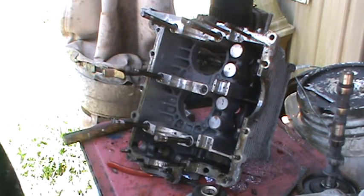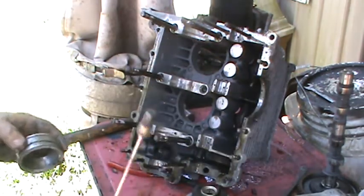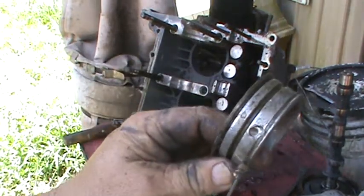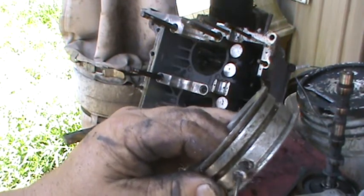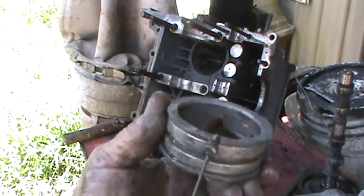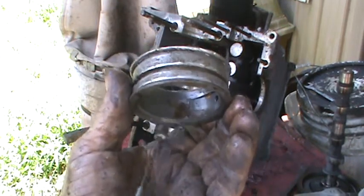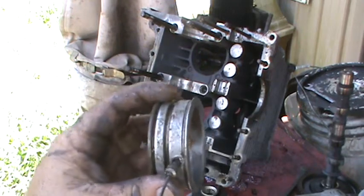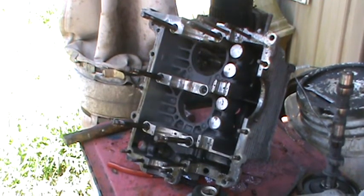This one's pretty much toast. A lot of guys would probably use this, but it's a failure waiting to happen. You can see the dowel pin that holds the bearing in place, and the hole — this more than likely happened during assembly. This is what I tell you guys: mark your bearings. Somebody put this together and smashed the dowel pin, and eventually the dowel pin went over in the hole. When you do this, it smashes the bearing in the back, the crank will seize up in this bearing. You can see how much copper is right where the bearing was compromised — it pinched the bearing right there. It's important to line those holes up and mark your bearing with a marker so you can get your bearing lined up with your dowel pin. That's what makes a decent motor go bad real quick.